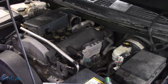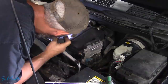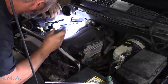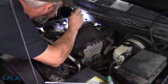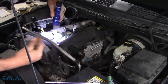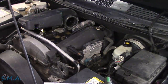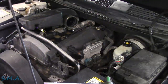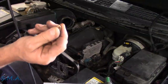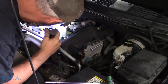I just want to see if we see any chewed-up wires, and I don't right off. So we're not going to go much further with this - just wanted to have a quick look. It just looks like regular hood blanket debris. Up here in the upper left-hand corner the hood blanket is chewed up, so hopefully it's just that - a couple nuts, some acorns. All right, let's proceed with our normal process - we just wasted a bunch of time, let's do a full system scan.